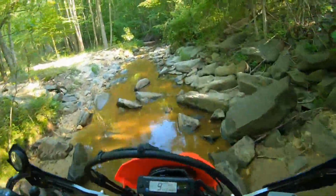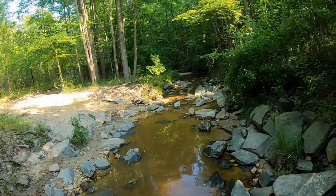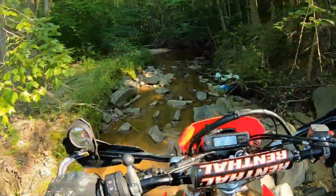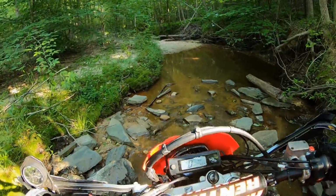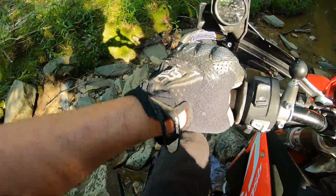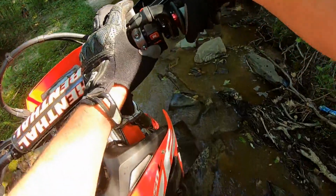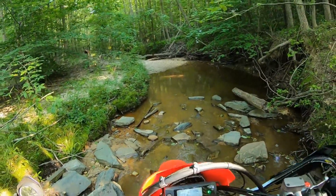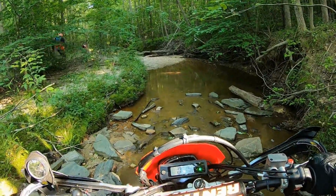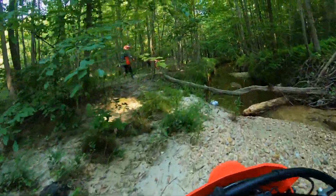Obviously, that starter gear was either misaligned or there was some play somewhere. I don't believe that even with the kickback it was damaging the gear that much. It shouldn't. The way that gear is designed, it's actually like a shark fin, each tooth. You can hear it, the backlash on the gear mesh is totally off. But the starter looked like it was in there all the way, and it wasn't crooked. There's not much room to move anything, so that's why I bought all the bushings and collars inside. I figured maybe I had a poorly machined bushing or something. I'll find out when I get it apart.